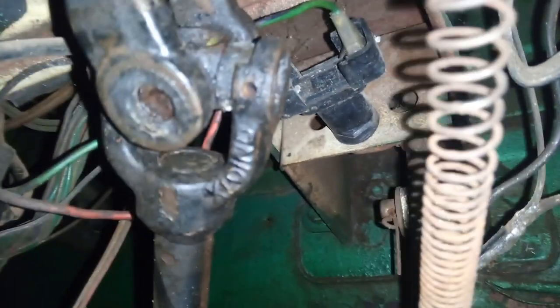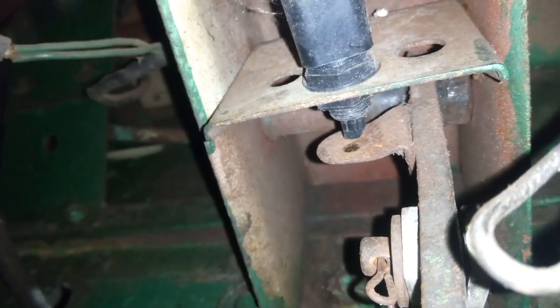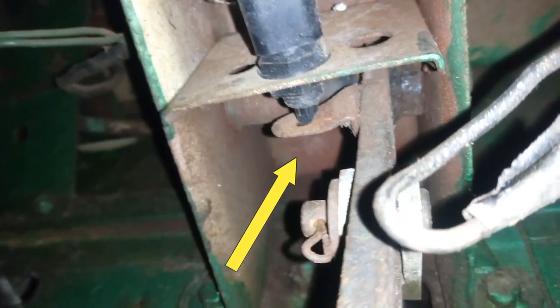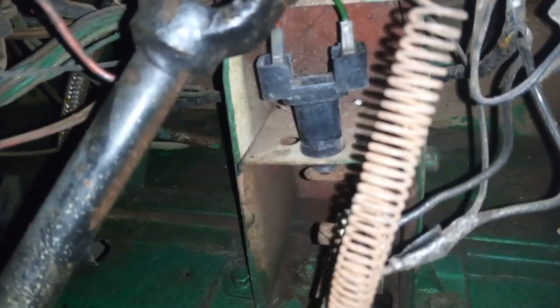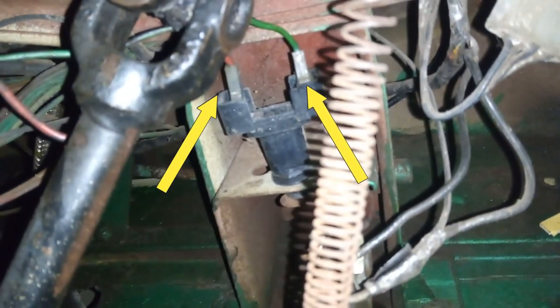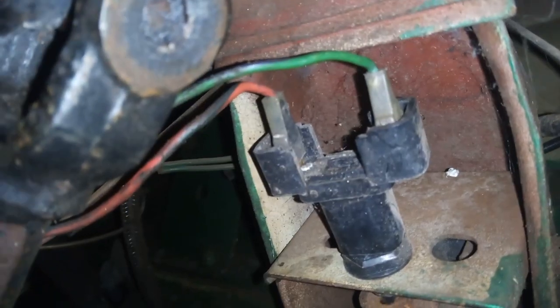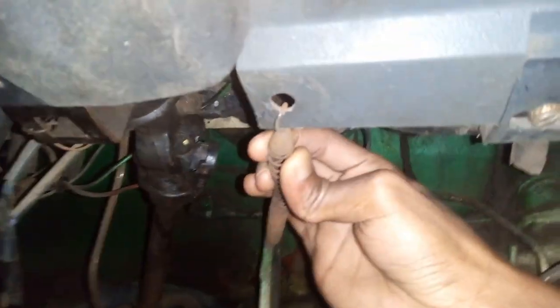Opening the door — the brake switch is situated under the dashboard. The rear park lights are working perfectly but both brake lights are not working. Most of the time this may be a problem with the brake switch. This is the brake switch of this car. Every time the brake pedal is pressed, the projection attached to the brake pedal presses and releases this switch, turning it on and off. Two current lines are coming to this brake switch — one is the voltage input line and one is the voltage output line.